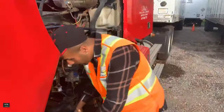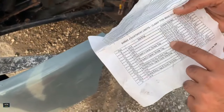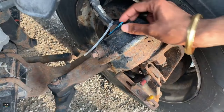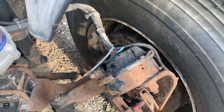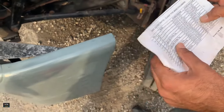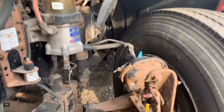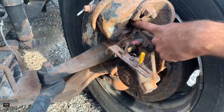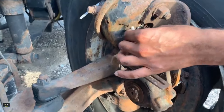On the chart, 172 millimeters gives two options: size 20 and 20L. To determine if it's a long stroke or regular, go back to the chamber and look for the blue tag and the square bump on the side. This means it's a 20L chamber — L stands for long stroke. The 20L chamber adjustment limit is 51 mm or two inches. Now use the soapstone to mark a reference point on the push rod, erasing any previous marks first.